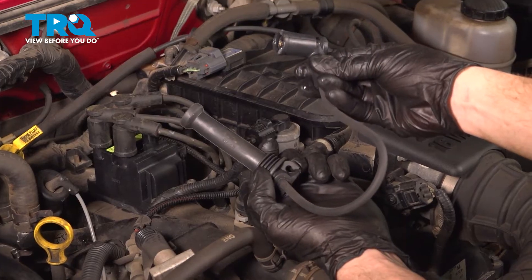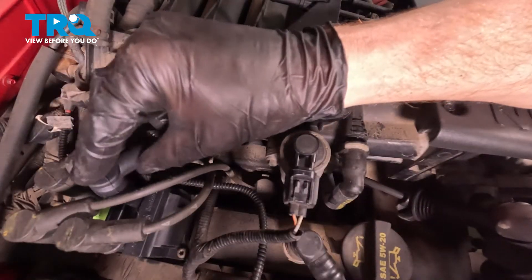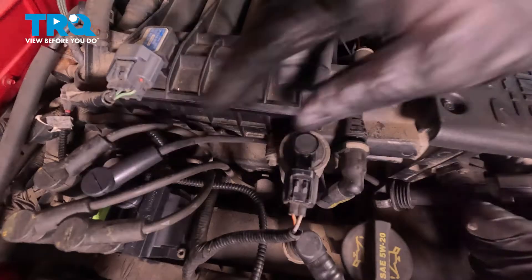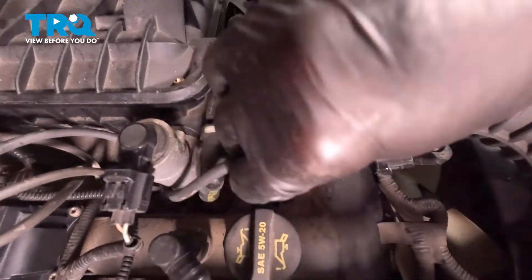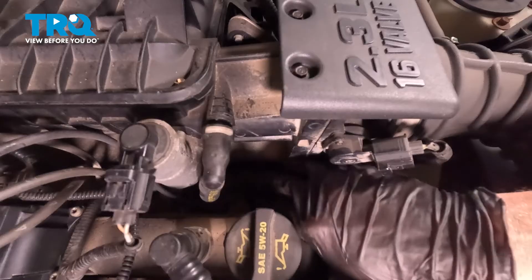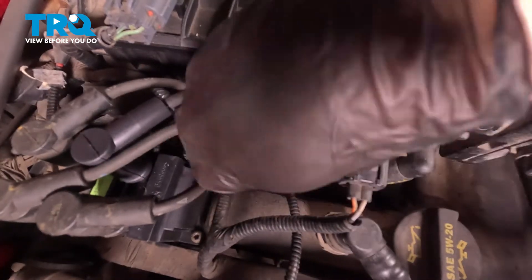Now we can take this and put it in position. Take that spark plug wire, bring it down through there. Let's plug this into the ignition coil. Press it on there as far as you can, give it a wiggle, make sure it's secure. We'll continue on along the spark plug side. Press it in, listen for a click, give it a little tug to make sure that's secure as well. It's extremely important to make sure you have a good seal so no moisture or debris makes its way into this area. Now that we've done one spark plug wire, do the exact same thing to the other three.